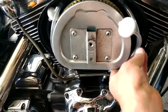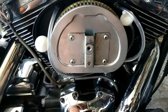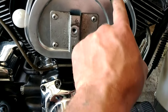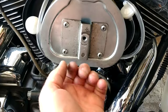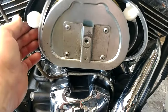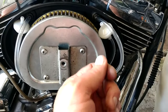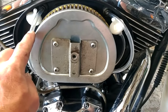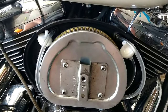The second principle is it's routed below the air cleaner and back up on the opposite side — there's one for each head, by the way. As it goes below in that extended path before it reaches the atmosphere, it has more time to cool. Then gravity can trap it below the air cleaner. And at the end, those lawnmower fuel filters are there acting as a baffle — that's the third principle. We're lengthening the path to give it more time to cool, trapping it underneath with gravity, and baffling any remaining vapors that might make it all the way to that lawnmower fuel filter. There's a little bit of mesh in there that will act as a baffle.